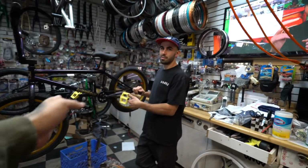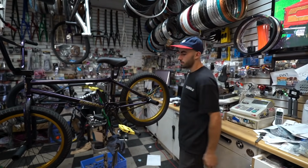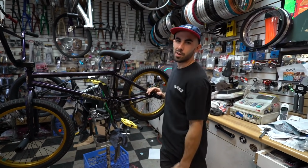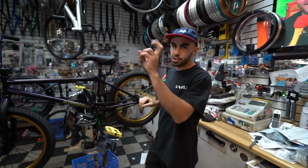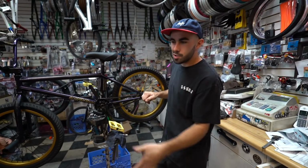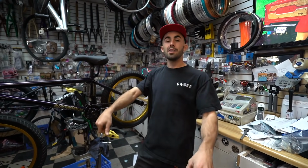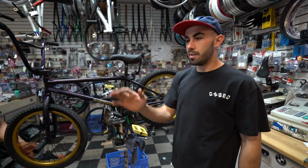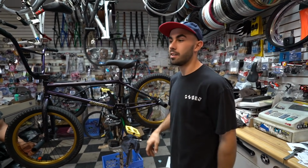Yeah. Now your chainstay length, that's more important to you. Chainstay length. So let's talk about chainstay length. Important. A lot of people like to have the 13 inch or even the 12.7, 12.5, the short backends, because it's good for street technical riding. It is super twitchy, super responsive, but it's so short that it feels way too easy to loop out. When you're doing a manual, you've got no stability because it's such a small balance point. You're really hanging on.